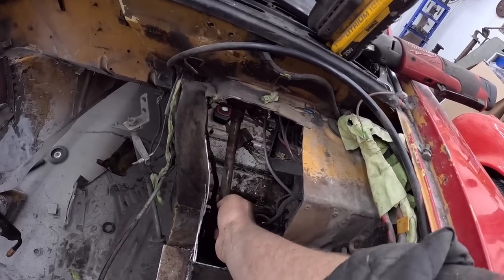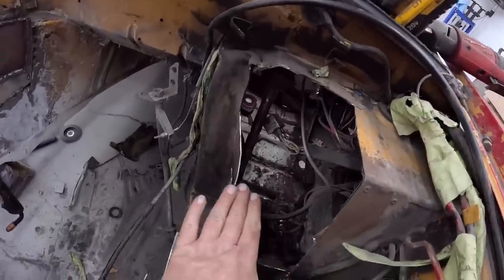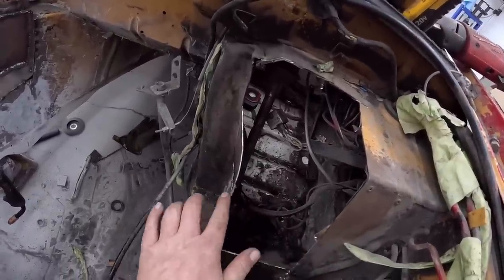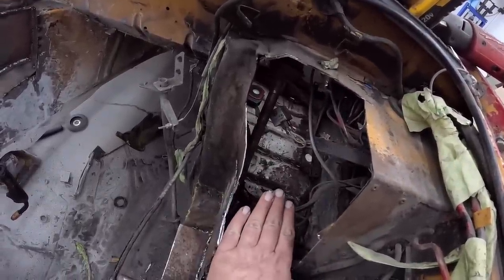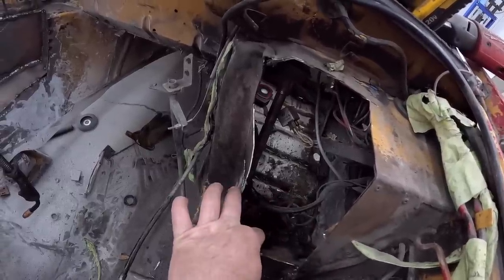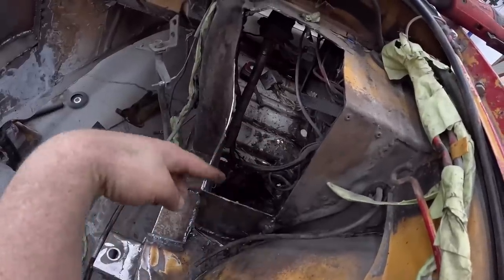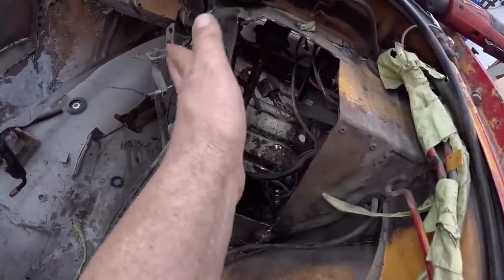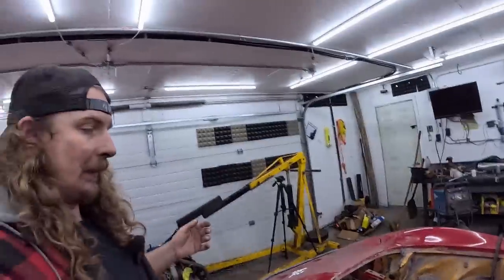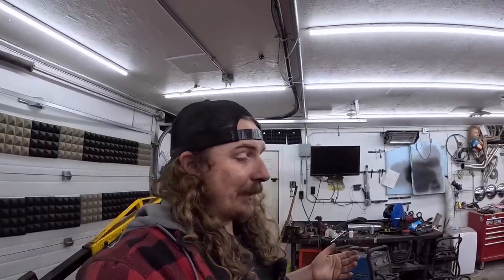And even that, if we had to go down and put a U-joint in there, once we have a top on here, I might weld this section right here with some of that heavy gauge plate, because worst case I could hang a bearing from it and go in. So that's another thought. And I think when I do this, I'll do two pieces, one square piece, and then whatever we gotta do on the sides and whatnot. But it's boring. I know it's not very exciting. However, when you're trying to fit motors in places that they've never been or whatever, it's a hassle.